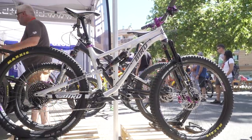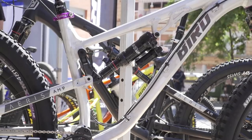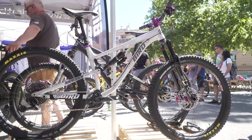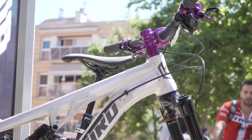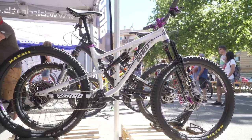Next up was Bird MTB. They hail from the UK — Swindon born and bred, as far as I know, and made in the UK too. Really cool to see them here because you wouldn't really expect to see them at something like the Monterey Show given they're a European bike brand. They basically make their bikes to order and they've got really progressive geometry. This one is the AM9 RS model — a 29er with 150mm travel front and rear, a steep 76-degree seat angle, 66-degree head angle, and 440mm chainstays. The reach is quite staggering: a size large is a 500mm reach, and their XL is 525mm. Fantastic value for money, with packages from as little as £2,400 upwards.